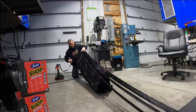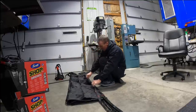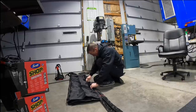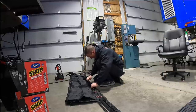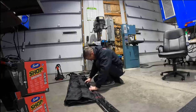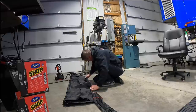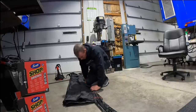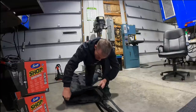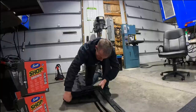I swap hands, got the chute, shroud lines are all looking good. Turn it, flip it over like that. Come right over here — there's eight panels, four panels but eight sides — and I take and line them all up. One, two, three, four, make sure they're straight, five, six, seven. It's a brand new chute so it's really slippery, and number eight. Get that lined up, make sure everything's looking pretty square, put a knee on it, pick up number one, pull, run my hand out to make sure it's not folded over or wadded up. Keep doing that until I've gone through all eight.